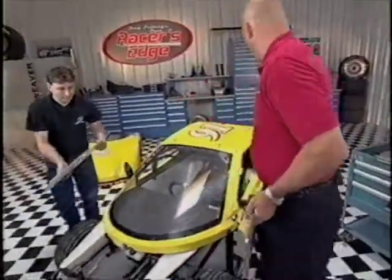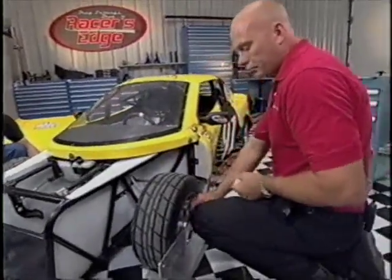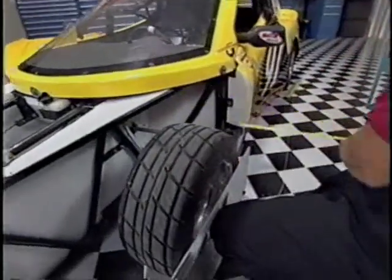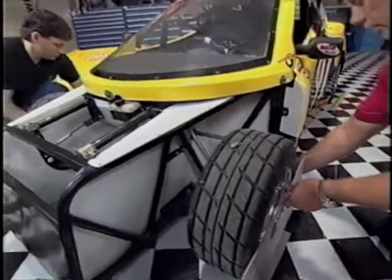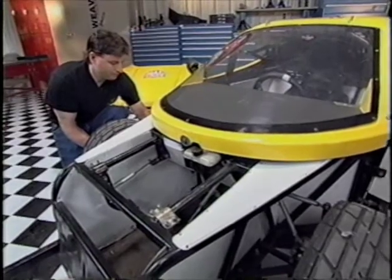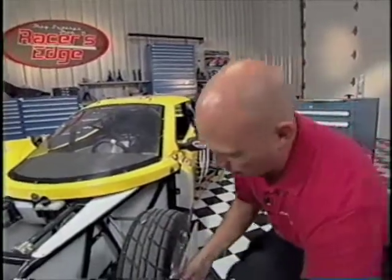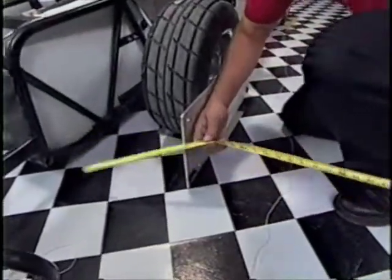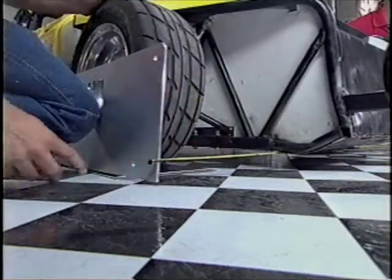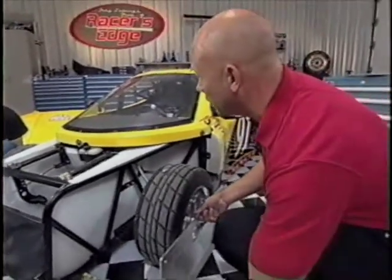Tim, take that toe plate. We'll get a tape measure here — basically this is just a piece of metal, true and square. What we can do is take a tape measure and run it across the back — get that side, Tim. Okay, it's hooked. We'll take a measurement here and we are 48 and 3/8 on that side. It's real important not to move your plate at all when taking these measurements, and always use the same tape measure to measure front and back for accuracy. We've got 48 and 5/8 on this end.